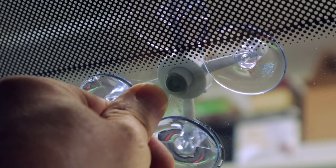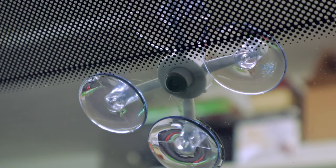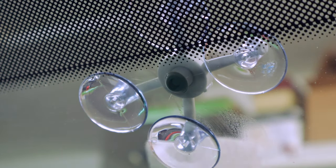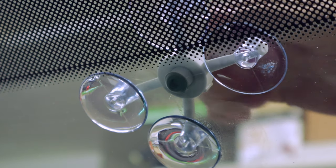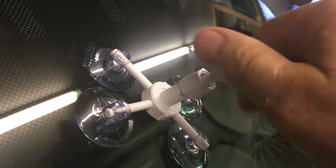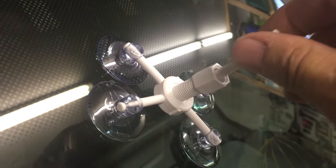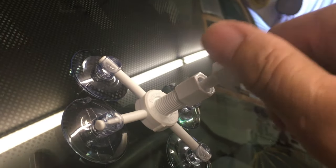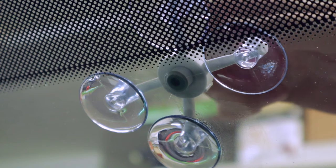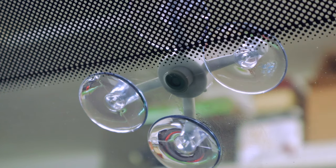Just a light press. Clean up any of the excess resin that you may have spilled. After that sets for five minutes, pull the plunger back out to let any air pockets out, and then reinsert it. After you do this, let it set for about another five to ten minutes, just so it has time to work the resin as far into the crack as possible.